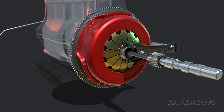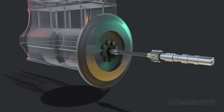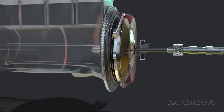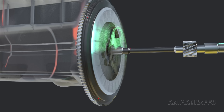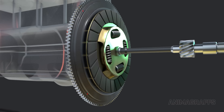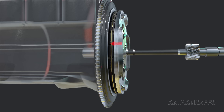Let's start with the clutch. The clutch assembly is securely attached to the flywheel, which is bolted to the engine — it's always spinning if the car is running. The components inside this assembly allow power flow to be disconnected from the transmission input shaft. Note that the transmission input shaft does not itself connect to the engine crankshaft or flywheel. Connection to engine power is accomplished with a sliding friction disc, sometimes called a clutch plate, sandwiched between the flywheel surface and a movable pressure disc. The clutch plate assembly is splined to the transmission input shaft but can slide back and forth. The pressure disc gradually squeezes everything together as the driver releases the clutch pedal for a smooth connection to engine power.